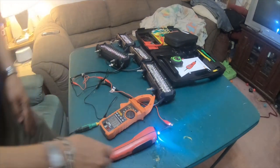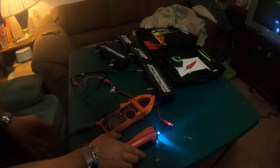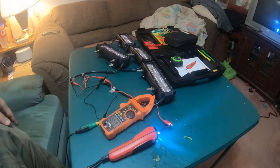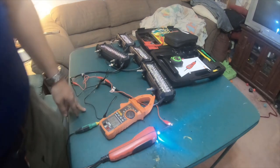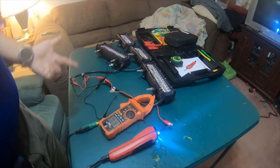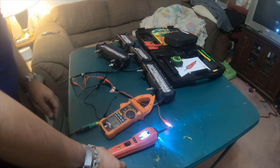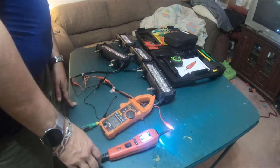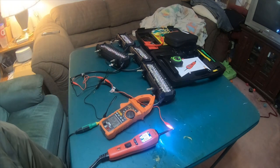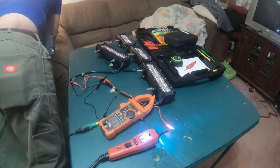So if I turn these on again, it's reading at 5.95 amps. So the battery in the house might not be able to push them because the longer I let the battery in the house charge, the higher the amperage goes. And the tip voltage is bouncing between 59 and 60 volts. So, let's see.